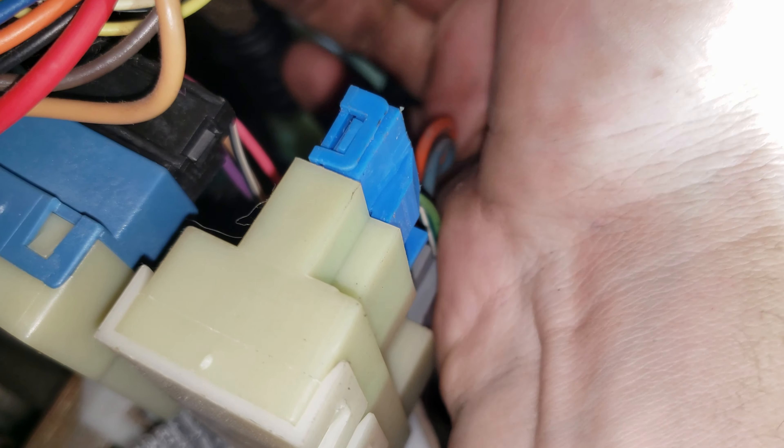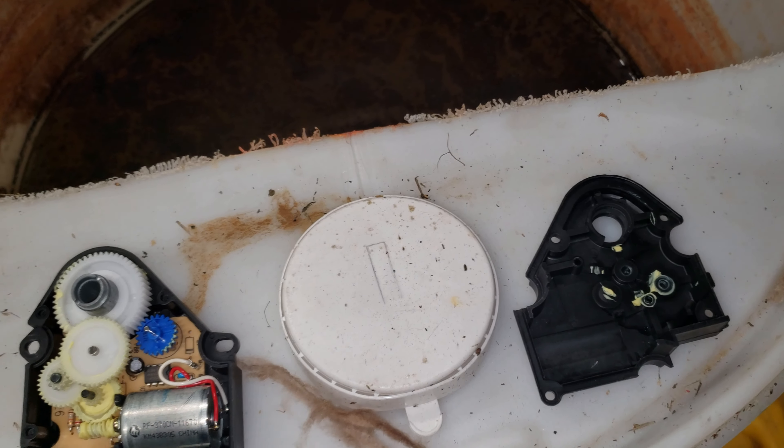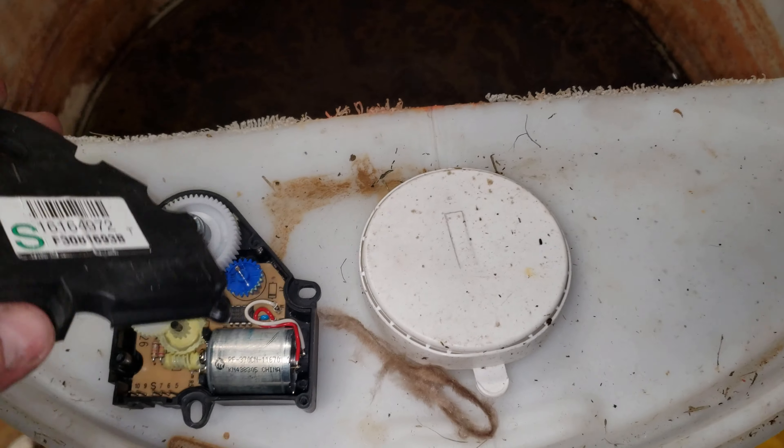The socket you're going to need is a 7/32nd. If we take a look at the new part, we can see it's got three mounting screws, so that'll be good to help us orient it — I believe this is roughly the orientation it's in. So now we just need to get those out. Once you've got the three Phillips screws out, you can see this panel is just going to drop down. We just need to unplug the three wires — at least I got three, this is the base model Park Avenue — and then we can get this panel removed.